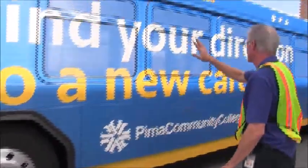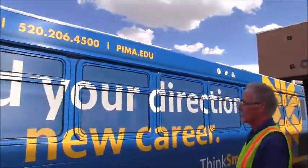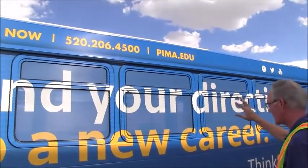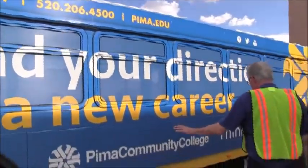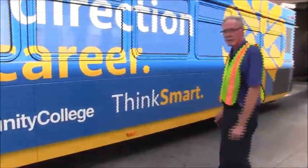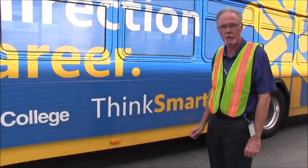We're going to inspect the sideline of the bus, and all of the windows are secure. None of the weather stripping is damaged. None of the glass is cracked or broken. As you inspect along the bottom, you would make sure that if there is a panel, an access panel, that you inspect that it's secure.